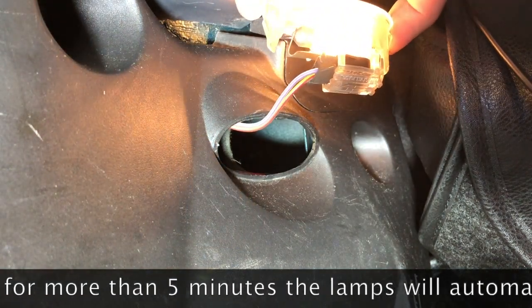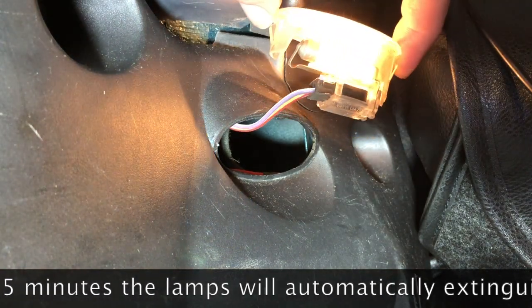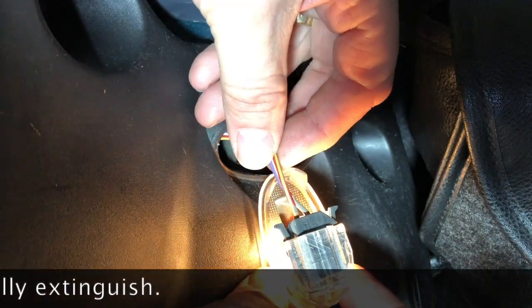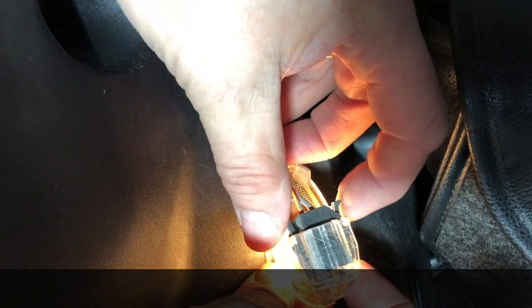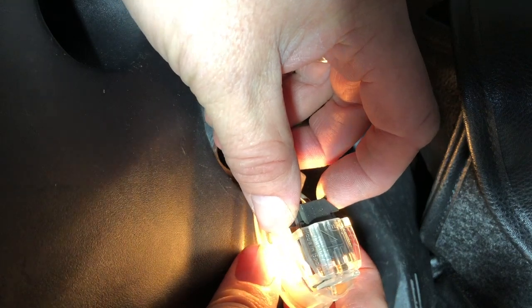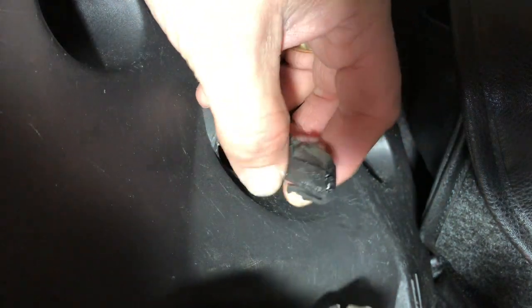If you're having problems with your lights, first protocol: check the actual lamps or bulbs. If you look at the back of the lamp, the electrical connector comes out nicely. You just squeeze the two ears and slide it back, and out she comes.